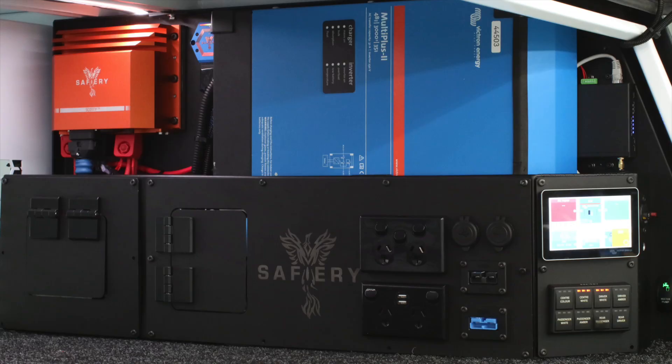On the driver's side, the metalwork from GCI is kept intact — that's the black section at the bottom. We've added some additional windows to get access to the breaker switches and fuses inside, and you'll see the Scotty in the top left. This is a standard factory alternator on the RAM, and we're comfortably getting 2600 watts out of it — I'd say we could get a little bit more. We haven't taken it at cruising speed yet.